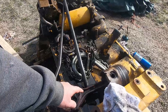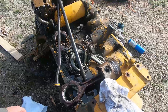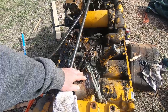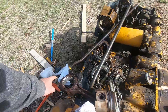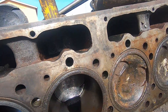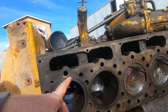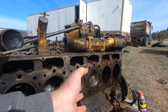As you can see, we've got some real damage on them. But I mean, this is all superficial. The wrist pins are fine. Even after we pounded this one out, everything looks pretty good. We're going to swap out these rings and put new rod bearings in — that's about it for the lower end so far. And probably, if you can see in there, it looks like the lifters are going to need to be replaced. But we're going to pull them out, clean them up, and if they're not hydraulic maybe we can just clean them up and reuse them.